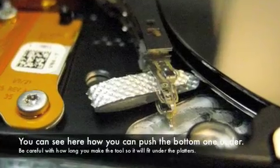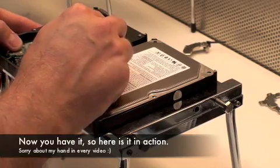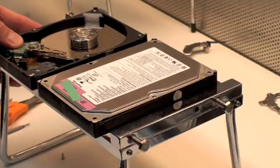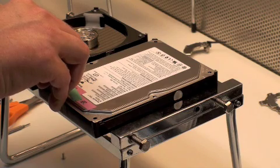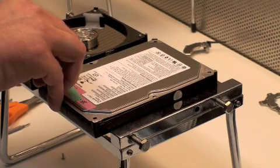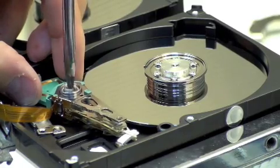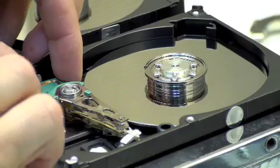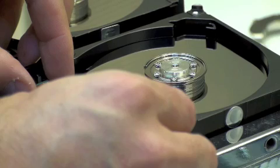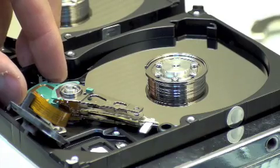There's nothing wrong with that top head right there. You use a piece of plastic from an overhead projector or something cut to slice to put that in place. Now you have the tool, and this is an example of me using it — I'm going to move the heads to the edge of the platter and then take my tool and insert it while it's right there at the edge of the platter and the two heads are still pulled apart. All I'm doing is sliding this to the end of the metal, not pushing on the heads, because the heads are very, very fragile and any pressure at the ends of the heads will cause you a problem. So all I did was slide that down towards the end of the metal. Then I removed the head assembly and I'm putting it on where my data is on the platter assembly that actually has the content I'm trying to recover. And then I'm just going to push it up underneath the edge of the platter to keep the head assembly as perfect as possible. It will be up a little bit off of the edge of the platter so it's not going to hit the edge of the platter and it's not touching the edge of the platter.